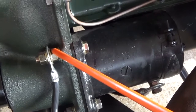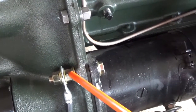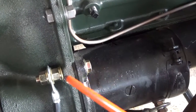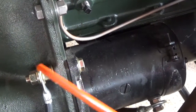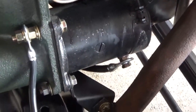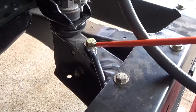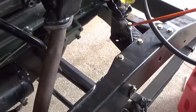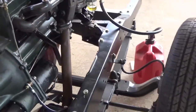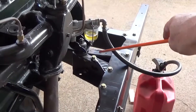This ground cable is a four-gauge switch-to-switch wire, 31 inches long, bought at O'Reilly's. I removed the old bolt, put in a two-and-a-half-inch grade 8 bolt, bolted the starter and bell housing back together, and added this ground cable on the end. I ran that line down along the frame and up to the motor mount on the passenger side, where I bolted it down to the frame. That gives me a grounding strap from the frame to the engine.